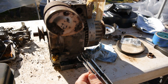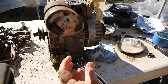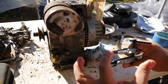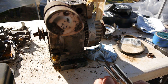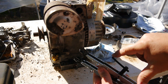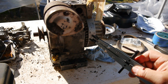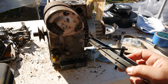You can see the adjustments here. You can spread it out depending on the size of your spring, the diameter of it. When you insert it, you try to go at the top of the spring and the bottom, and make your adjustments for the width and diameter of the spring. When you get it in there, you just rotate it down to compress the spring and you're able to pull it out.